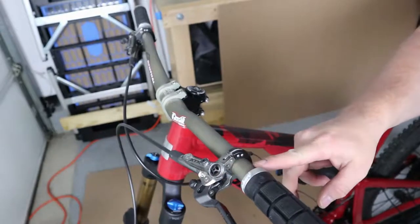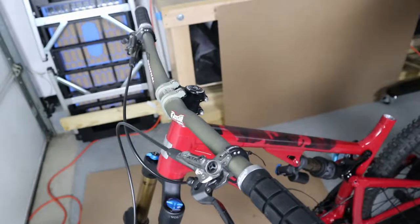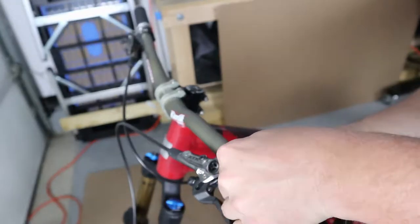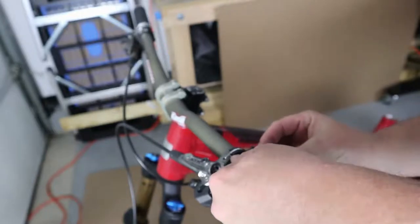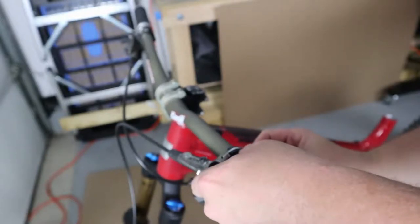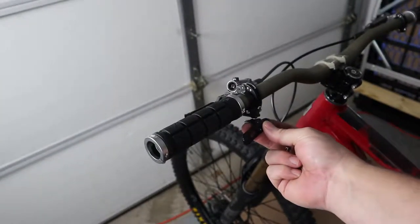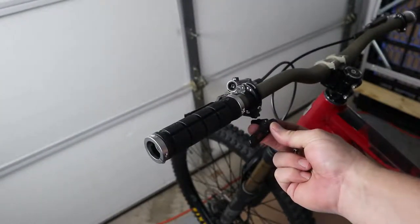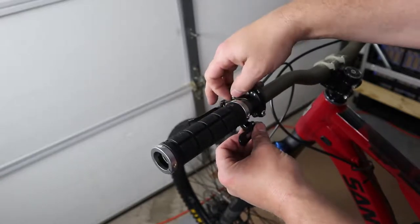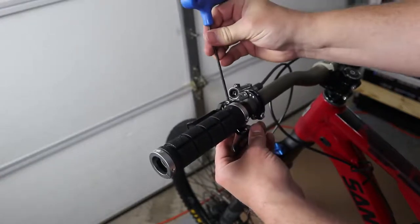The lever is going to go here, just inboard. I'm actually moving the position of the lever this time to be more in line with how a shifter would be. Since I have a 1x12 system, I no longer have a shifter in this part, so the lever would be down here like a shifter. I'll get a good light and tighten it here — that will give me an idea about positioning.